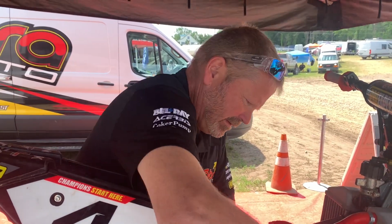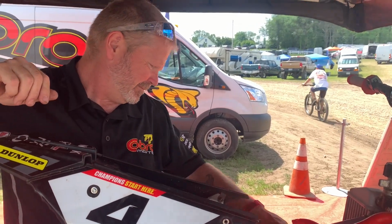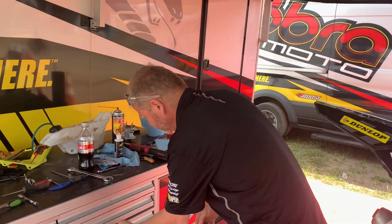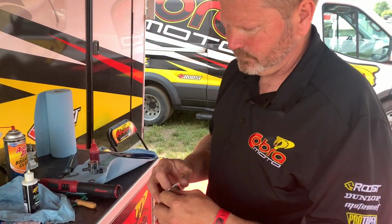So I can tell you, on the stands, a lot of times if we take one bike and we put a really tight squish and a really loose squish, you definitely can tell the difference in the bikes on the stand. It'll give it different characteristics of how they perform on the track. So it's something you definitely want to pay attention to.